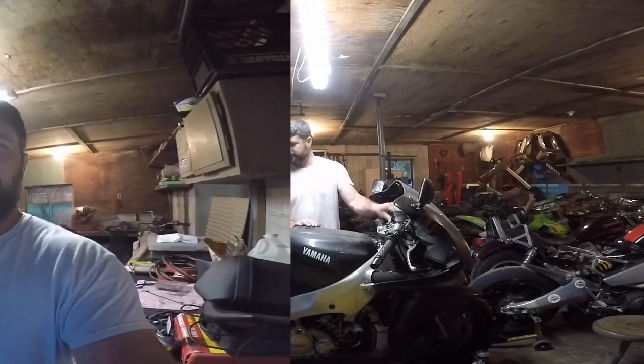So it starts! It's going to need some work. The verdict is it does start. I know the ignition system works, I know it's getting fuel. The carburetors are going to have to come off and get cleaned because it doesn't idle and I don't think it's running on all four cylinders — it doesn't sound like it is. But other than that we're at a good starting point. It did start, it did run. With any project bike you're going to run into this stuff, so I'm not really surprised it immediately died. I'm actually surprised it started at all — that was really cool.